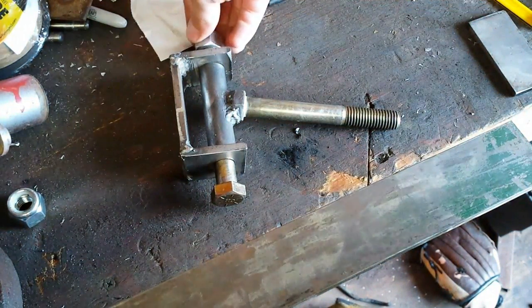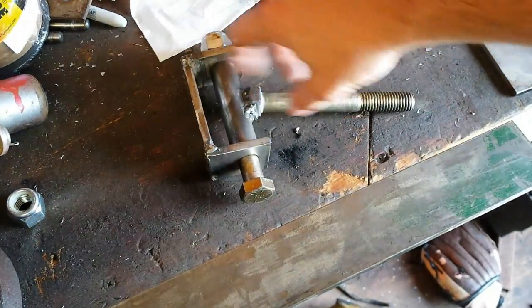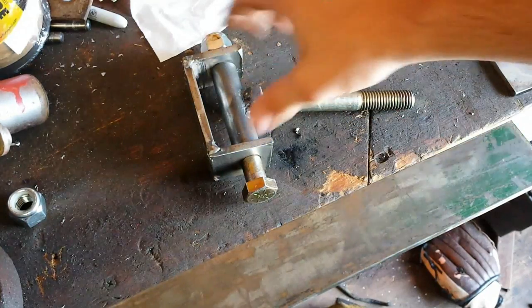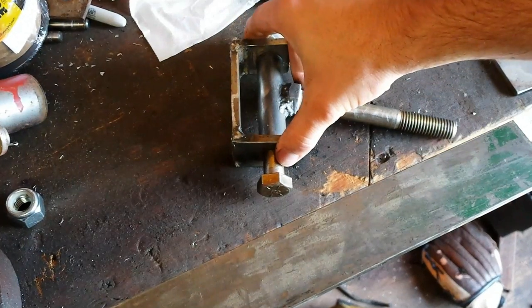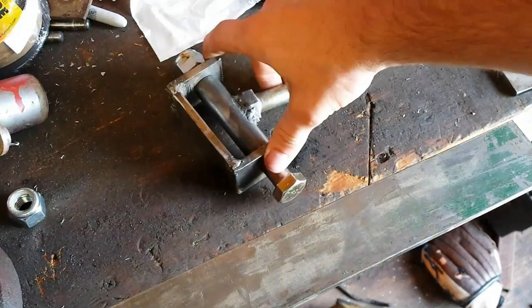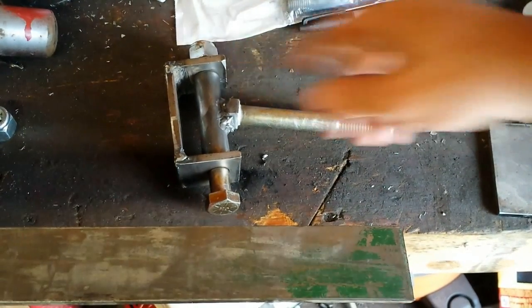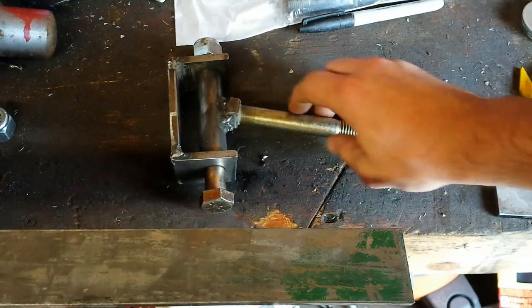And you put your nut on this end down here. And then whenever you cut your axle, we'll cut it at a positive 10 degree. I'm just going to call this one a negative 10 degree. So if I've got my axle cut at a positive, and this is a negative, what it'll do, we'll say the axle's right here. You'll turn it in like that right there. If you'll notice, now that's straight. And your axle will be at a 10 degree down here. So, now that I've showed you what it looks like, we're going to build the second one.